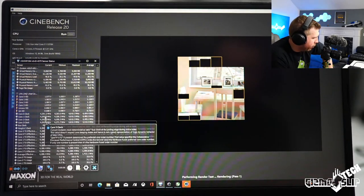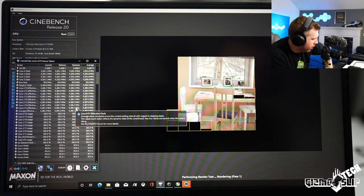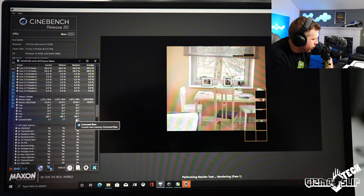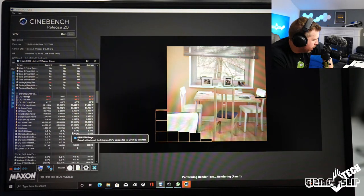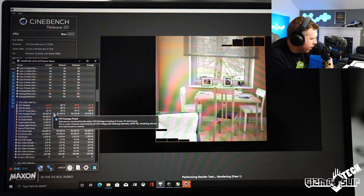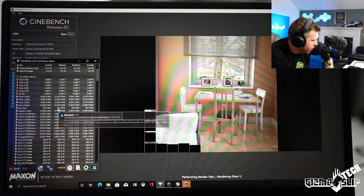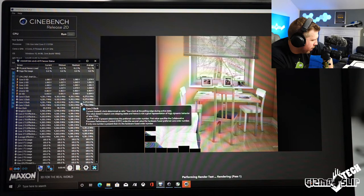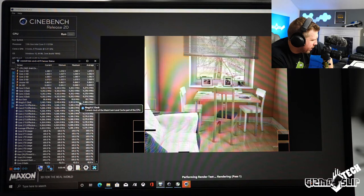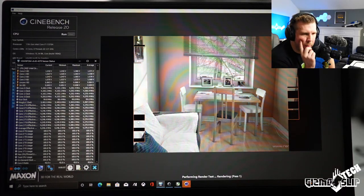You can see right now we're averaging 4.3 gigahertz. We're still in our initial boost phase of the CPU, so we'll see if it drops down. What are our TDPs like? Our temperatures are spiking into the 90s, averaging 90 right now for our overall worst case CPU temp. Our TDP, core package power, is 54.5 watts, which is pretty good. That's actually a lot of power going into this 4-core CPU. We're averaging 4.27 gigahertz across all of these cores at once. We should be nearing the end of the initial boost phase. I'm curious if this is going to drop down lower or not. I feel like we had a slowdown there for a second. Something else may have happened in the background, because it didn't move for like 10 seconds. Yeah, this is only a 4-core Intel.